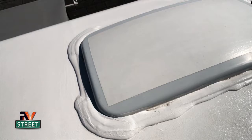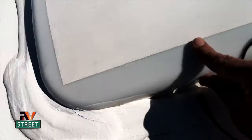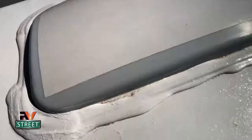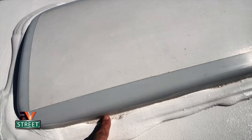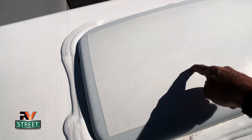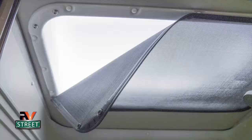But in addition to that, I taped this off and I painted the top of this with the same material that I did the roof in, which I'm going to tell you about in a minute. But I left this little bit here. You can see there's about 2 inches and an inch down there. That allows enough sunlight to come into the skylight and into the shower area, but 80-90% of the sun that beats on this thing is blocked by this coating and the sunscreen up underneath.